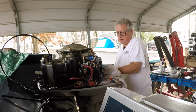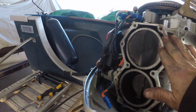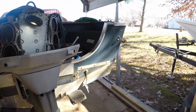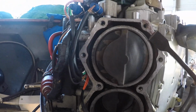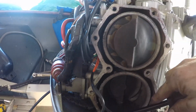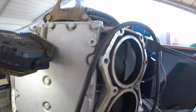Well, I just talked to the customer and he wants to replace both head gaskets. Clean up the surface maybe a little bit. Yeah, I've got just a gasket scraper. Just try to be easy on it. Don't go crazy. Just make sure there's nothing really, any old gasket material, whatever.